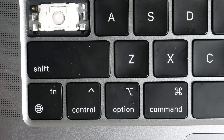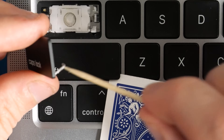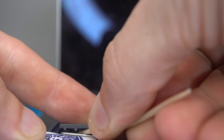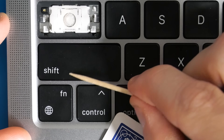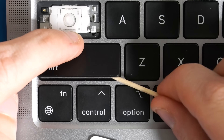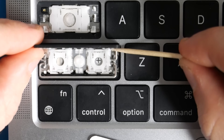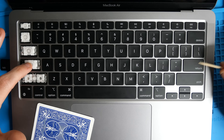Now the Shift key — a bit more of a pain. Same corner-to-corner approach. There's a support bar at the bottom and at the top of this shift key. Pry in between the bottom support bar and the key cap to separate them; easiest from the corner. Run the toothpick along the key and you'll hear it click a couple of times and see the support bar drop. There are actually two key switches with lobster clips at the bottom and awning clips at the top to pry up. Once released, pull towards you and lift the key cap out. The top support bar sits in a little channel with hooks — leave that one attached and remove the bottom support bar.